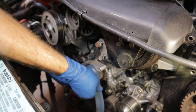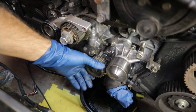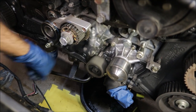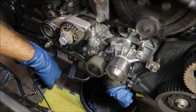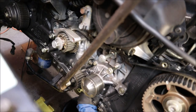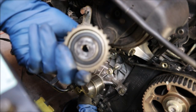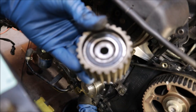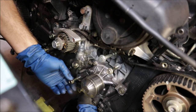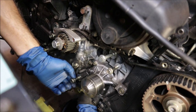Here's another important one — if this explodes it'll probably take out the timing belt. Doesn't seem like it should be spinning that fast with that much noise. Off it comes. Sounds alright but it's really not worth the risk. It is Japan so that's a good sign. Starting to see all the filth in here being exposed. Looks like the oil pump needs some work. That's for sure.